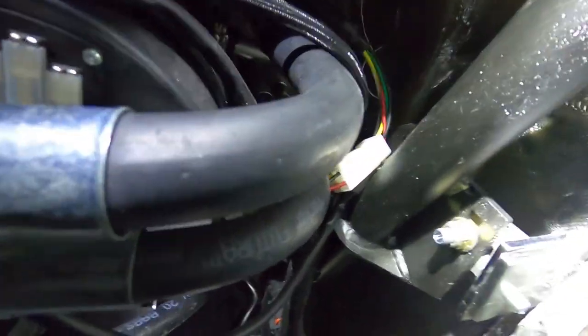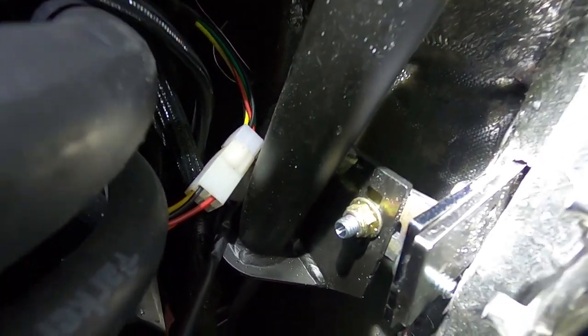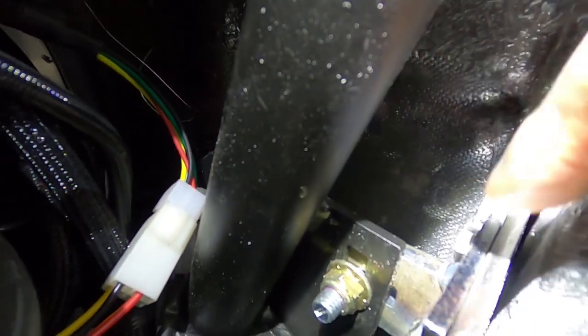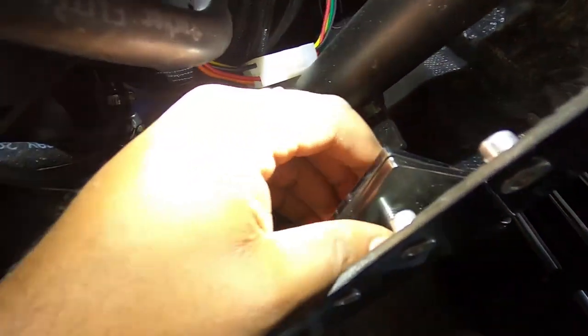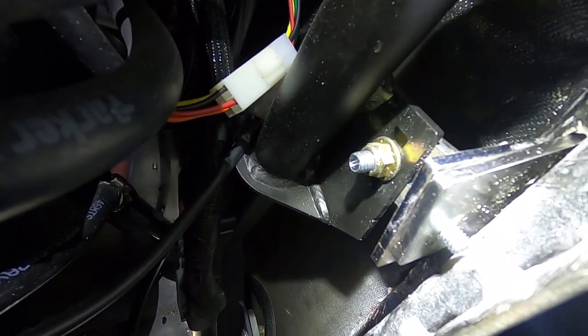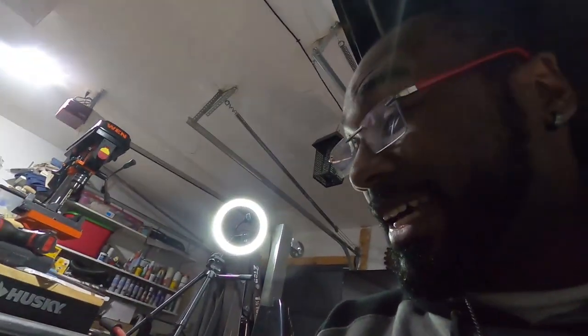So the instructions baffled us for a little bit. When we did the drilling through these metal plates, only the top hinge and the outer hole, so this top hole right here, when you're looking at it like this, is the one that's threaded. Everything else gets drilled with a 5/16, and we use the carriage bolts, and that's how you do your adjustment. And same on the bottom, but I have the carriage bolts, but somehow I have no idea where the nuts are. So I am going to have to buy some nuts.